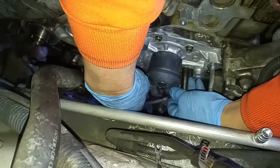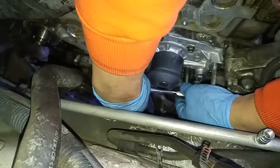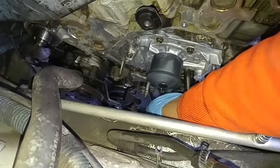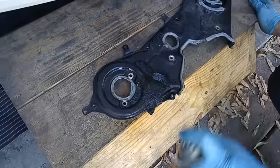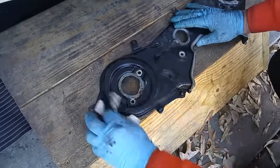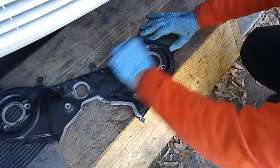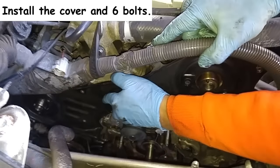I'm going to apply the final tension on the water pump nuts and bolts using a quarter-inch drive because you won't run the risk of applying too much torque and potentially shearing bolt heads.